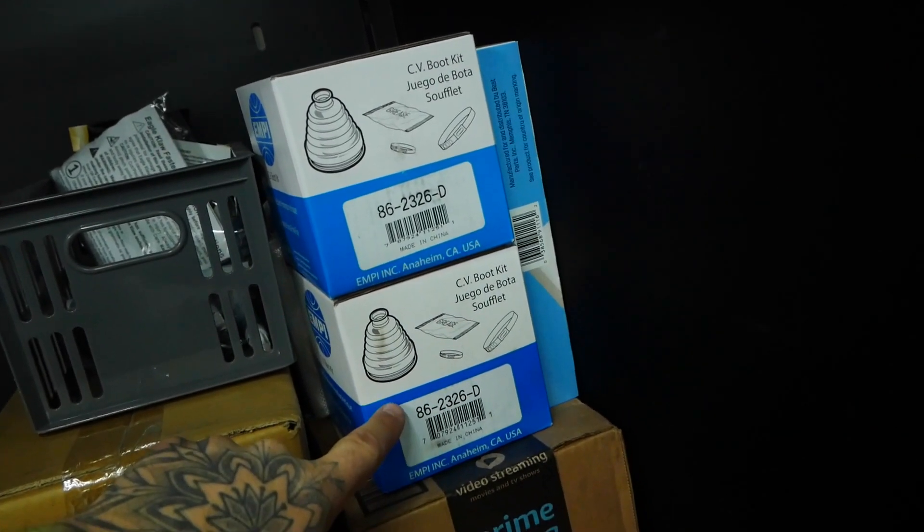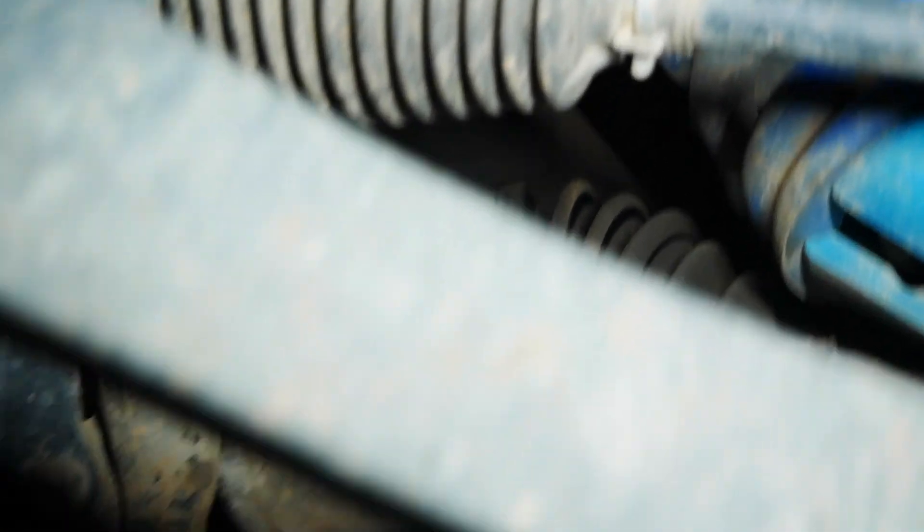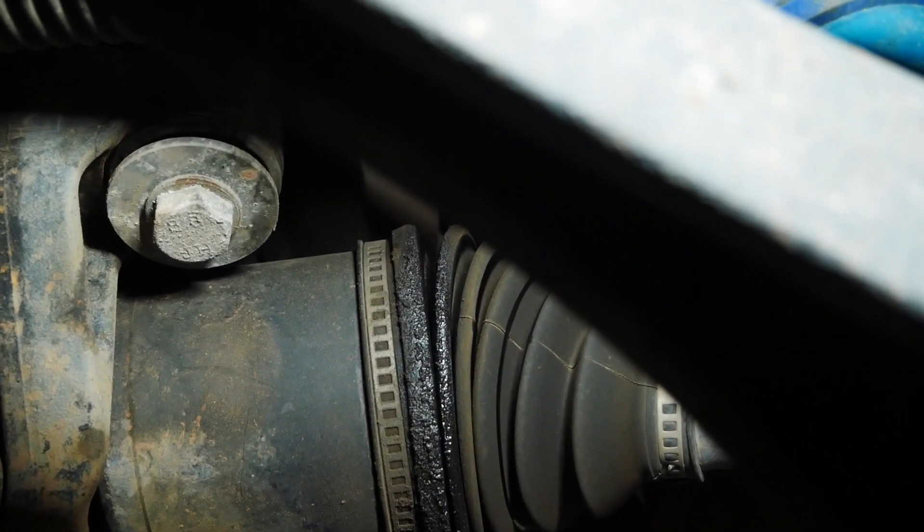Let's swap the cars around. I'm going to explain what we're doing with the truck. I've been putting this off — I've been waiting on one part to do this whole thing so I only had to do it once. I've been putting it off for so long that I forgot I already ordered this and ordered another set. From what I've seen, it's the inner CV boot on just the driver's side. You can see it's all greasy — that's a telltale sign your boot has a tear in it. I've changed these boots at least twice on video, possibly three or four times, and these are the heavy duty boots, so that's kind of bullshit. That's the part we've been waiting on, which is why I haven't done this project just yet.